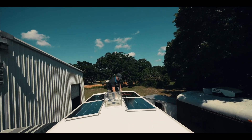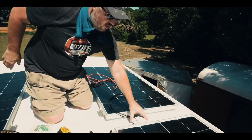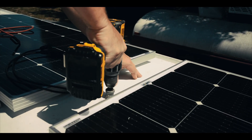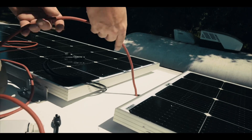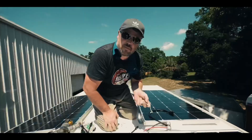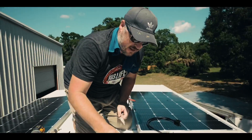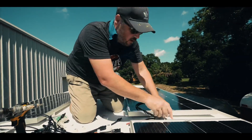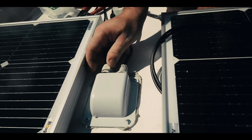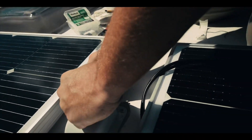The next stage is cutting our hole in for our wire to come up through, and this cable entry box will sit over our hole. Make sure when you're doing a bus conversion you order plenty of butyl tape because you'll need it. We're going to place our through-box over the hole and get it set nicely in place. As you tighten these caps down, it causes a seal to form tightly around the wires.